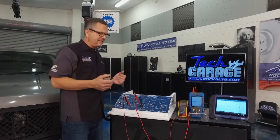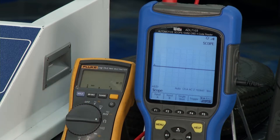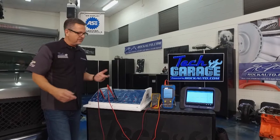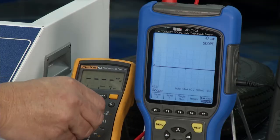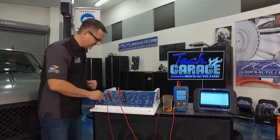The passive sensor has no voltage going to it — it's your old wheel speed sensor. It generates an AC voltage. You can take ohms of resistance right here; I've got the ohmic value. You can check that sensor — it's about 800 ohms, look at your service manual. Or you can check AC voltage — it produces an AC voltage. I'll fire it up and you can see what's going on as I turn it up and down; it actually changes voltage.